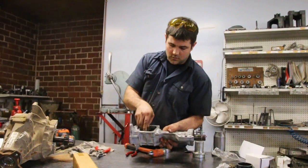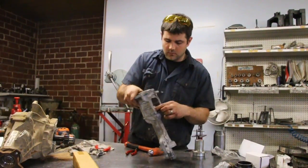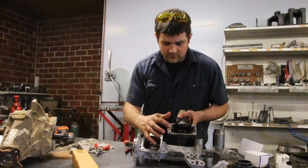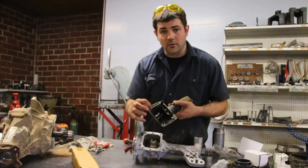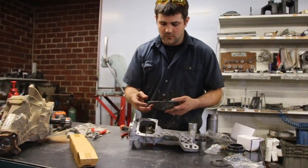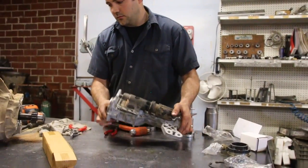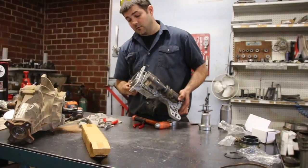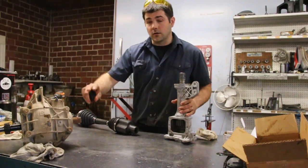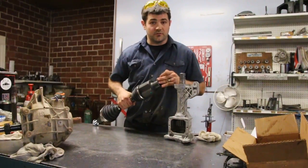You'll want to put your collar on and then take your actuator. Up here it does corrode a bit, so a small skim of silicone or RTV could work fine just to ensure a good seal. It is a reusable gasket. Once you throw that back on, it's just your four 12mm bolts, and then simply slide it back onto the differential. At this point hopefully you have your housing back on your diff — it's all up in your truck — and the only thing we've got left to do is put the CVs back in.